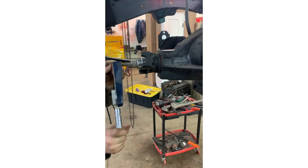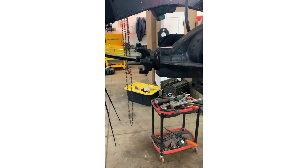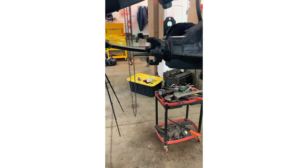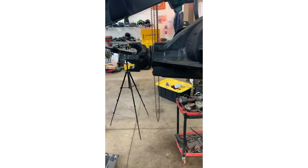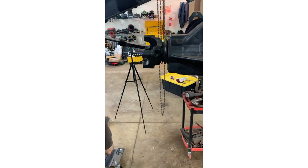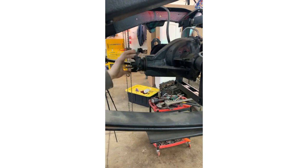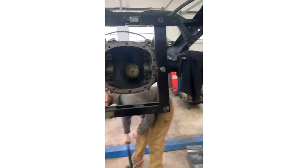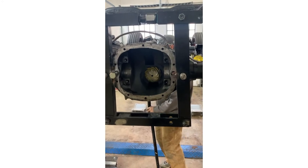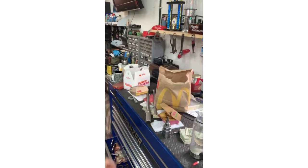We've got the pinion in its final setup now - seal, new bearing pressed on. We ran down the main nut until we achieved a rotational torque of around 29 to 30 inch-pounds, which is within the 20 to 32 range we've found. We're comfortable with that as far as resistance goes. This part is done. Update: we took a lunch break for some energy, then got back on the rear end.